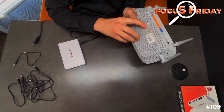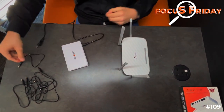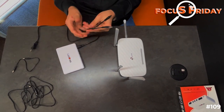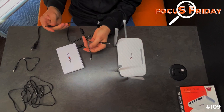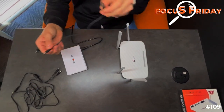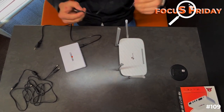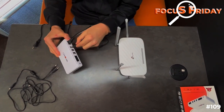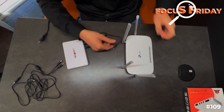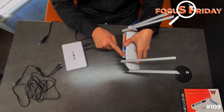Its power is 12V 1A. I put it back down and take either my splitter — if I've got a modem and a router both 12V — or I take a simple DC 1 to 1. So let's say I use the DC 1 to 1 right here; it goes into my 12V output, then to the input power, and my router is already on.